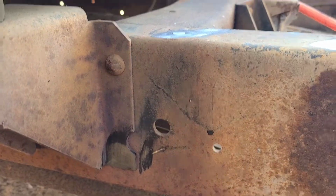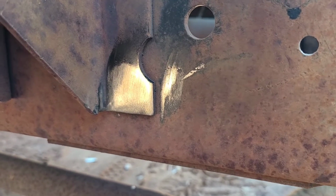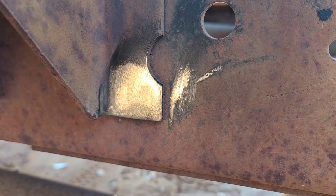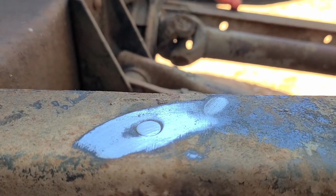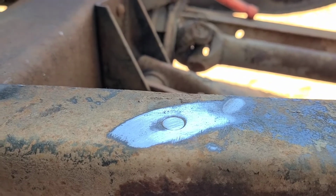Okay, so this is what I'm talking about. So obviously that's how the rivet starts. Then you hit it with the little flat pad, and you can see it's not gouged hard. You can kind of see the outline where the rivet is, but you can just get down the edge and you just do it real neat. So that's my tip of the day.